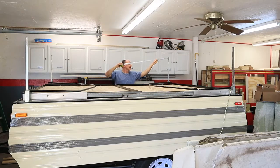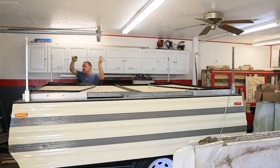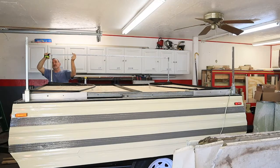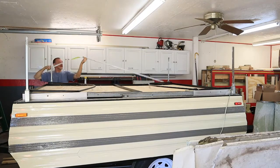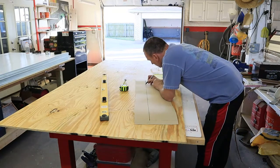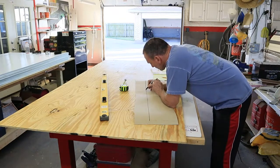I'm building this new top from scratch. I had a few leftover rotten pieces from the original top, but I'm not using any of them in the rebuild. I had to take measurements from the rotten pieces and from the trailer to figure out how to build a new top. The original top was built flat, and after a while flat tops will sag in. Somebody suggested building a curved top to help with runoff and also fight the sag that will happen later on.